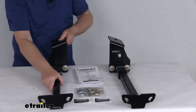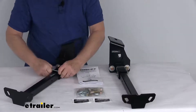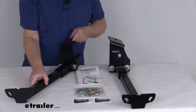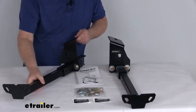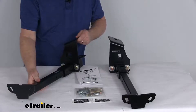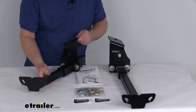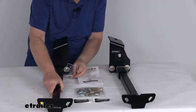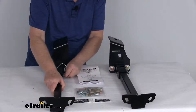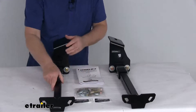What's also nice is they are adjustable. If you pull this pin and clip out, the insert will have two holes at different lengths. You can put it on the last hole if you have a wide camper, or if it's a little bit narrower, you can slide it down onto the smaller hole. Once you get it on the correct hole that you need, just line the hole up with the pin, slide the pin through and clip it, and it holds it into place.